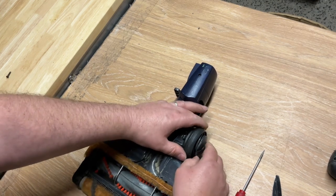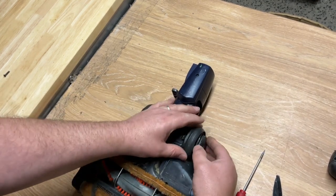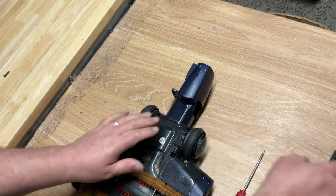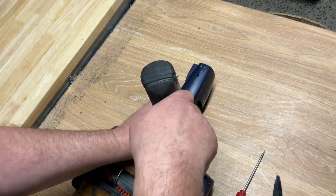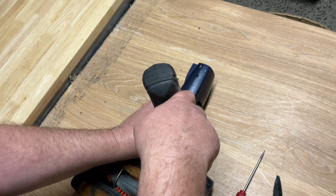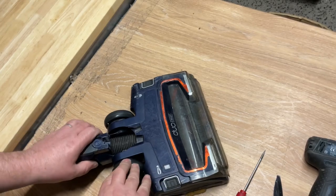When refitting, you've got to push it in but then pull it back out slightly to get a gap. Otherwise the wheel won't spin freely on these. The principle is the same but yeah, that's an important step.